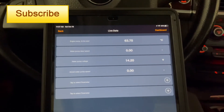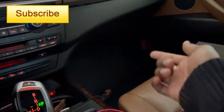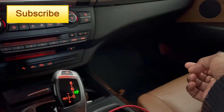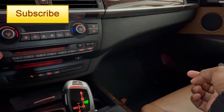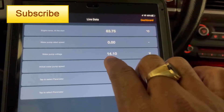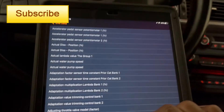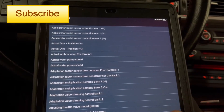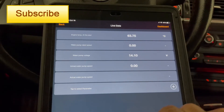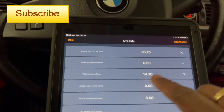I was going to check the fuse, because the manual says the fuse is under the passenger side footwell. The fuse box under there has a number 47 fuse for the water pump and a few other things. But based on what this is showing, voltage is present, yet both water pump speed readings — rated and actual — are saying the same thing: zero. The voltage is still there but the pump is not spinning.